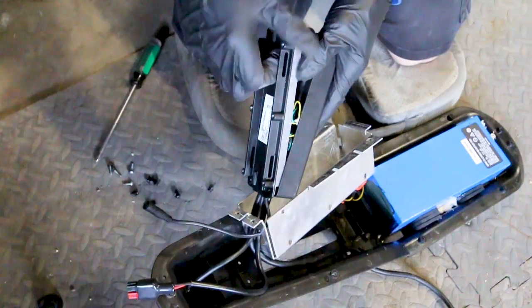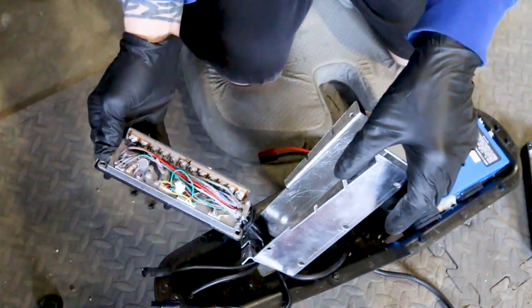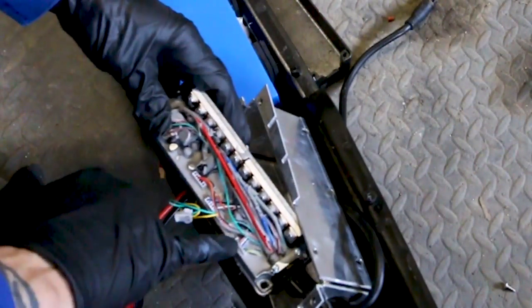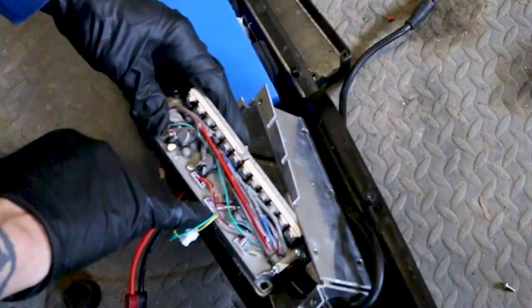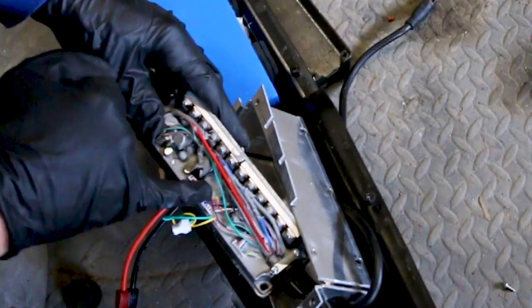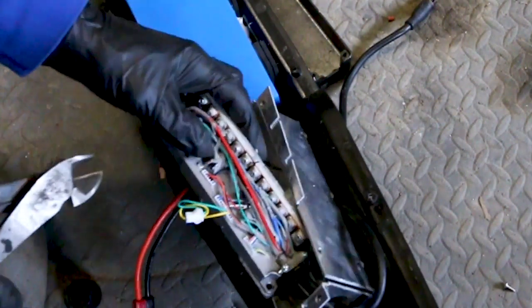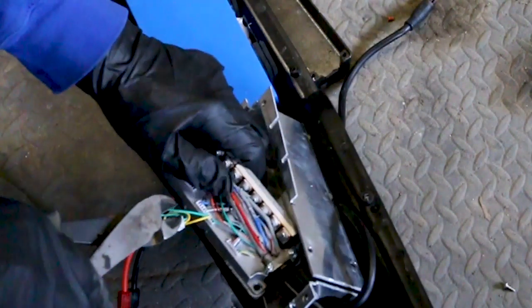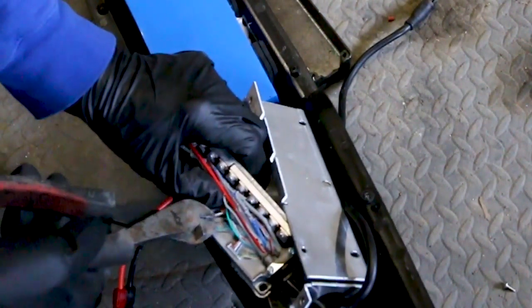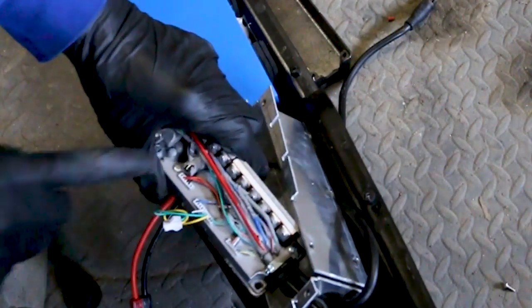Once those are out we can get to our controller — you just have to slide this down the wires a little bit; you're not going to get a lot of room. This is the actual controller here and you can see it's for 36 volts. There are four more screws to take apart, then slide it open and there is the inside of the controller. There are two clusters of wires — a short one, a long one, and another short one. On the middle one there is a white wire, and that is the wire you're going to cut for the speed hack. I'm going to cut it up a little ways and leave some wire hanging off just in case I have to redo it. You can see I cut it there.